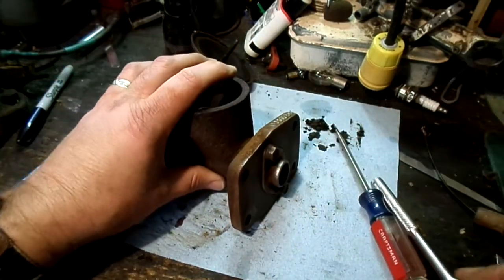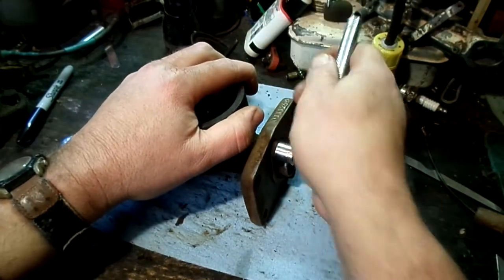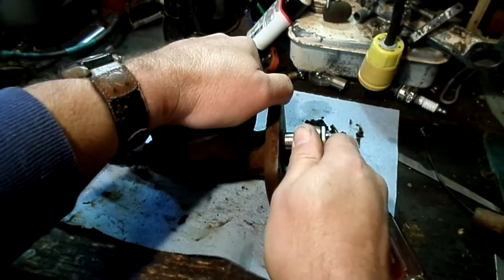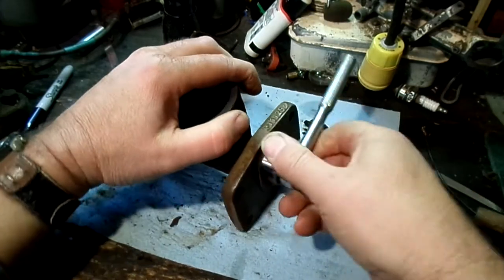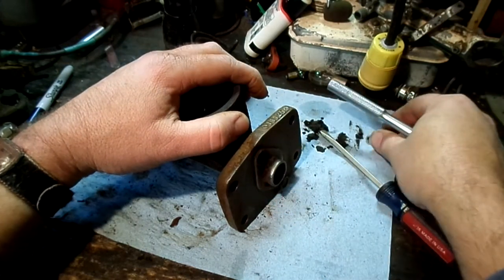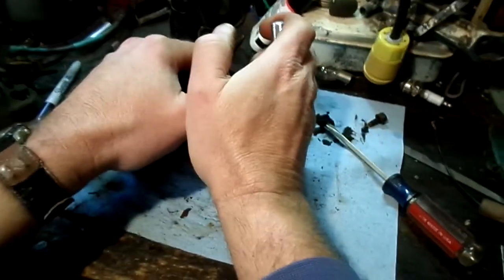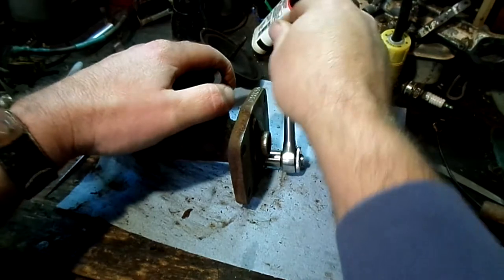The dual reservoir is a safer brake system because with a single pot system, if you get one hydraulic leak anywhere in the system you essentially lose all four brakes. Typically it's not as catastrophic as it sounds because you don't usually lose brakes all at once — you lose a lot of pressure and you get a heads-up that it's time to get off the road because your brakes are about gone.